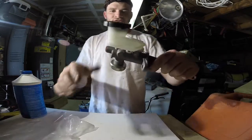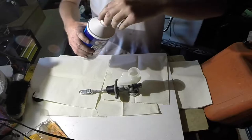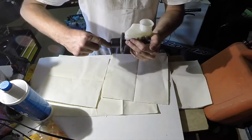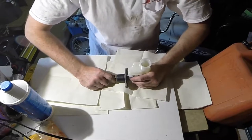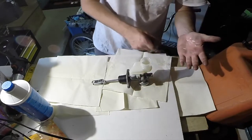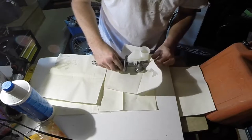So I got the new master cylinder right here — Duralast product. The name says 'last' so you're hoping that it'll last, and it's actually a lifetime warranty. I'm gonna attempt to bench bleed this right here right now. I'm just gonna add a little bit of fluid — just enough where it's not gonna be sucking air. So I'm just slowly feeding fluid, bubbles come up. I'm gonna hold this plug really tight because it'll come shooting off if you don't. Slowly release the shaft. It's shooting out on the other side now, so at least there's something in the system — that way when I bleed it it won't take like seven hours. Bench bleeding is done.